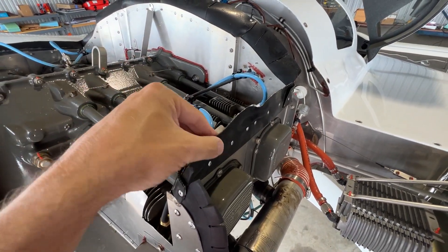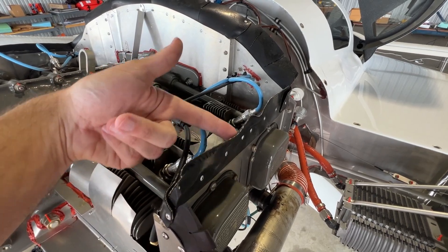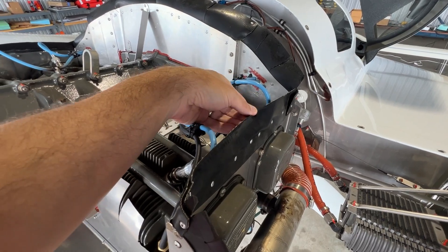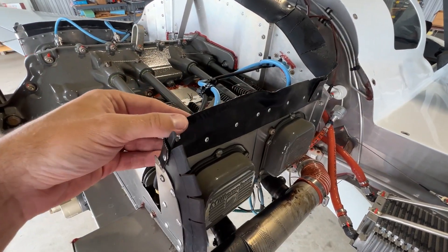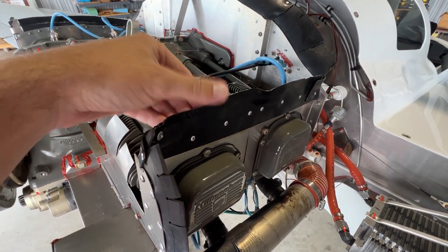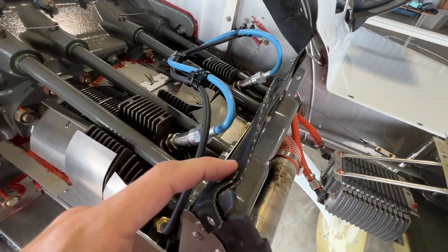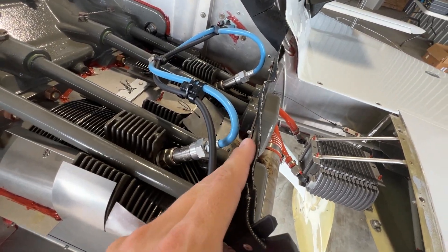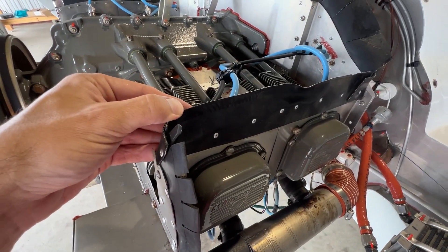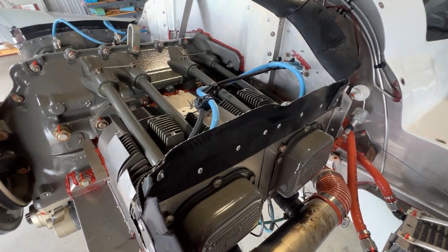What I would normally do if this blows out is reach my hand into the baffle and poke it back onto the other side, but it's sort of deformed itself pretty badly in the center here. So I think I'm going to drill this out, get some new baffle material, cut one to the same shape, and then maybe see if I can bend this hard baffle out a little bit. Not exactly sure if just replacing this is going to be enough of a fix, so just got to get to it.